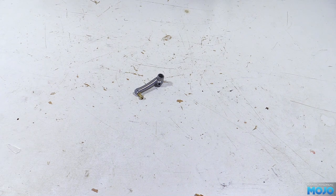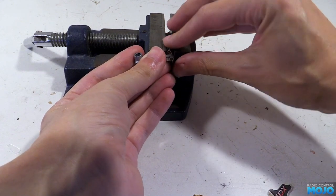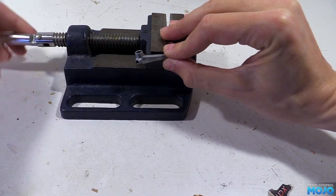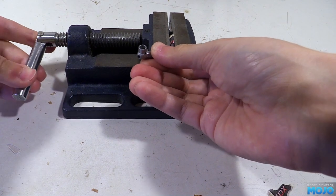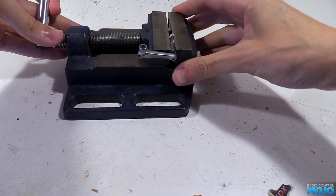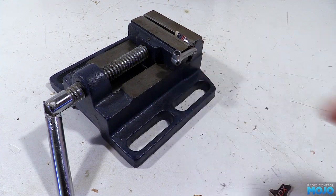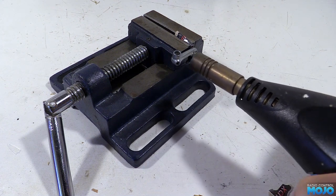We're going to need to get the upright to around 180 degrees C, so to save getting singed, we'll clamp it in a vice. We don't want to grab it close to where the spindle goes, as the big vice will draw the heat away very quickly. I'm going to use some more cardboard for protection and clamp it up at the ball end. Alternatively, you could put the entire vice and the upright in the oven at 180 degrees C for 20 minutes — that's exactly what you do when changing bearings in an RC engine. A heat gun would work a treat to warm the upright up, but I like a bit of fire from time to time, so I'm going to use a torch.